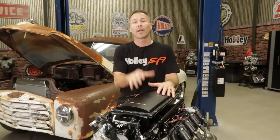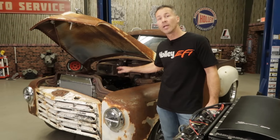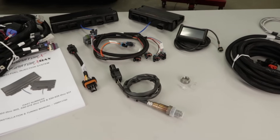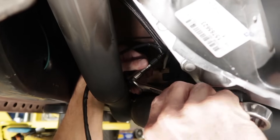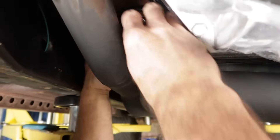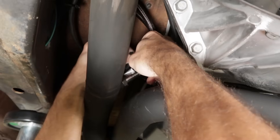I thought it'd be a lot easier if I used this mock-up engine to show you how to connect all the sensors, but I wanted you to see it in action. So I brought Stewie in as my guinea pig. I've gone ahead and connected all the harnesses to the engine already, so there's just a couple more things to finish up and we can fire it up. You'll find a Bosch LSU 4.9 Wideband O2 sensor — this is a critical part of Terminator X's self-learning capabilities, so make sure that you use the sensor provided with the kit. The installation is straightforward, but before you weld the bung in, be sure to follow our O2 install recommendations found right in the manual. Connect the supplied adapter line between the O2 sensor and the connector found on the harness. To prevent any meltdowns, make sure that all the wiring is positioned and secured as far away as possible from any high heat sources as well as all moving parts.